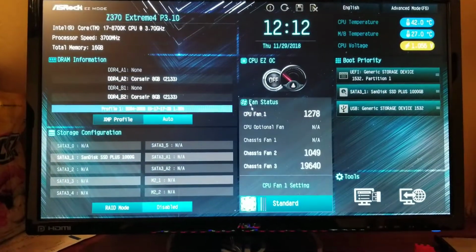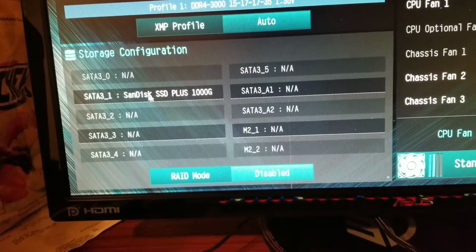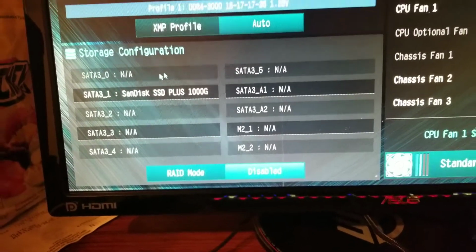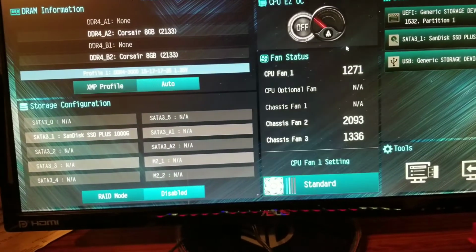So what you do, make sure you get the boot device going. Let's see what's going on. So usually it's F2 or delete, sometimes it's like F1 or something, to get to the BIOS. So go into the BIOS. They actually ended up putting the hard drive on the wrong SATA port. Apparently it's the upper one, not the lower one, but it should be fine. He's not plugging anything else in there, so we're not going to worry about it.